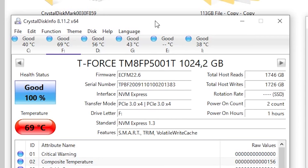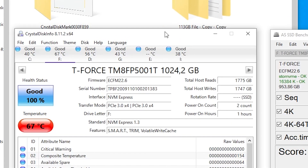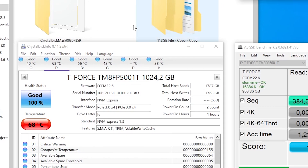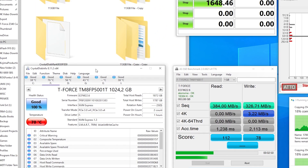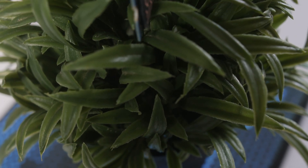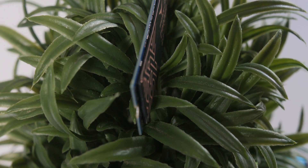After about 20 minutes of intense stress testing, the maximum temperature reached was 71 degrees Celsius, which isn't that great really. But given the small size of the heat spreader and we didn't add anything extra on top, it actually did decently well. The Sabrent Rocket, which did have an enormous heat spreader, also saw a max of 71 degrees Celsius, which is the thermal throttle point for most SSDs. It did reach 70 degrees but didn't thermal throttle that much — it lowered somewhat but nothing too drastic. Our stress test is quite over the top and unrealistic, so most of the time you won't even notice that. And if your motherboard has a heat spreader for your M.2, you can pop that on and it will help out quite a bit.